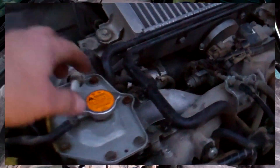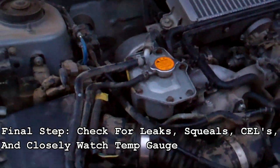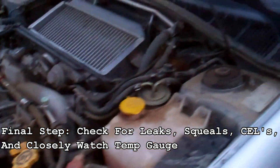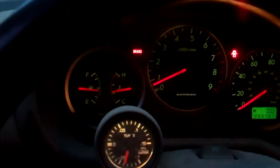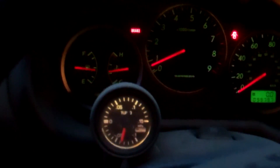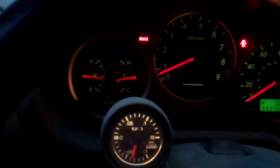We've replaced the top cap as soon as it wouldn't accept any more water, and we've checked for leaks, made sure the belts aren't squealing, everything seems to be in order, no check engine lights. We're running the heater on high and our temp gauge — it's been running now for a good 10 minutes and it's not even at the halfway mark. If it goes above half or close to three-quarters, shut it down, as that would mean you probably still have air in your cooling system. Let it cool off, then re-burp and refill the coolant.